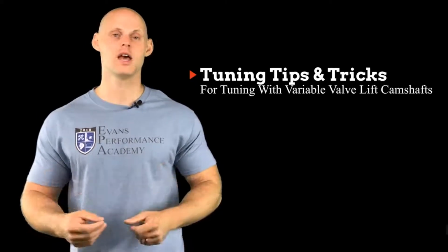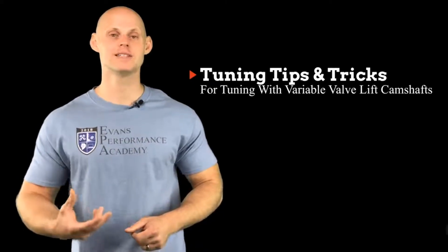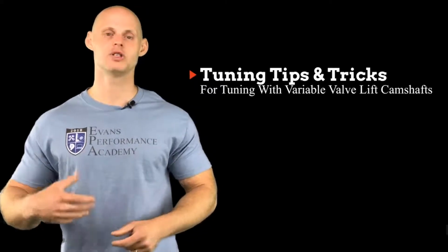So if we're tuning an engine at, say, 6 psi, we might find that the VTEC point is at 5,000. Then if we tune that same engine and turn up the boost to something like 20 psi, we might find that we can lower that VTEC engagement point to something like 4,500 and still be smooth and aid the turbocharger in spooling faster. That's just because of that scavenging enhancement effect as we're pushing more intake air mass in and having more air mass come out and spool that turbocharger faster. So that's something to be mindful of when you're tuning a turbocharged engine with this VTEC function.